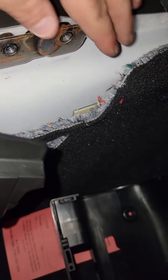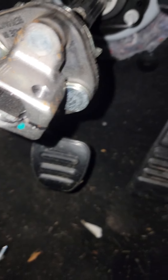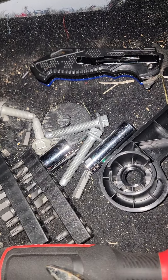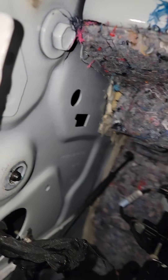There's one spot here and one spot there — I think it's actually sitting underneath. There are two spots with two little clips holding the wire. You have to get that off to remove your steering column. There's a T40 bolt that goes there. Undo that one, and then there are four bolts — two up high, two down low — and that's all that's holding it on. Once you undo all those, you pull it right out. Same thing on this side — there's a bolt there and there.